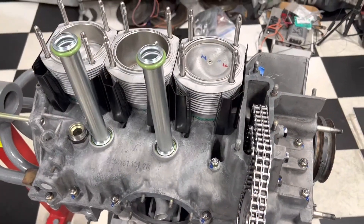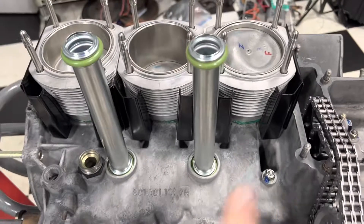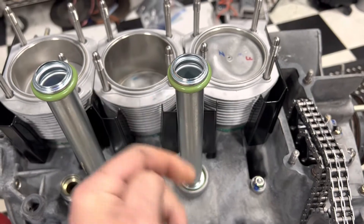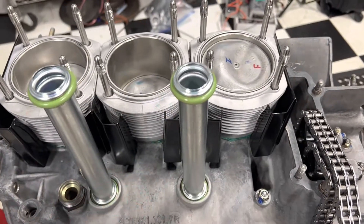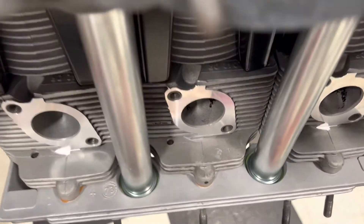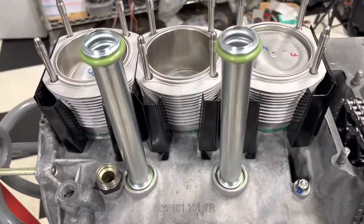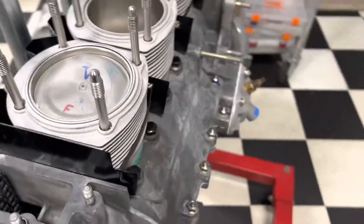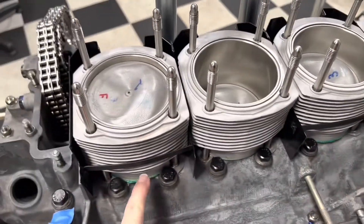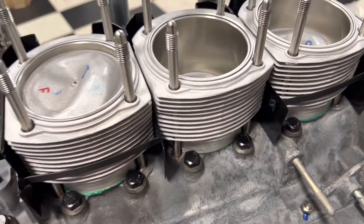The engine is prepped and ready for cylinder head install. We use Moly coat to make sure the o-ring gasket doesn't roll, because if it rolls it'll thin out and that's why you get bad seals. On the one we installed, you always want to look down in there and make sure the seals went into the cylinder head well. As for the air guides, the older motors only have two of these little latching mechanisms; the newer, bigger motors have a third one that goes in the middle.